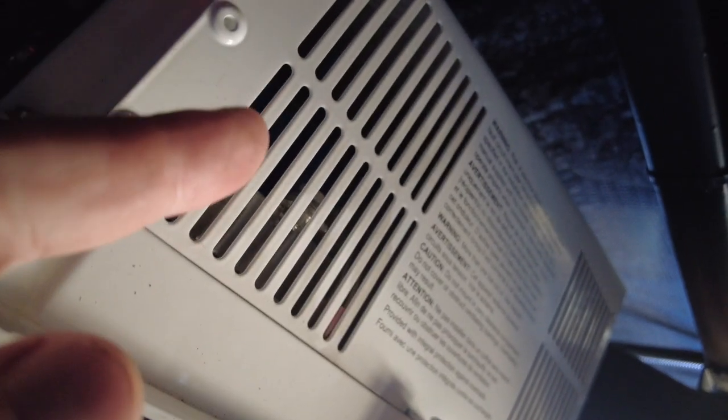This is the inverter — it's protected and a little inconvenient to get to. The flashing light means it's in a float mode. Right above this green light, where my finger is, there's a power button to do a soft reset. You unplug or disconnect from your AC power, then come under here and press and hold the power button for approximately 15 seconds. The green light will then blink rapidly, and once it does that, you let go — that's a soft reset.